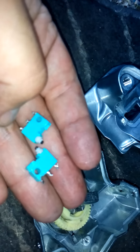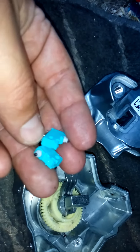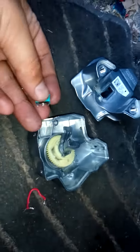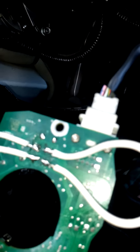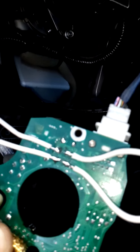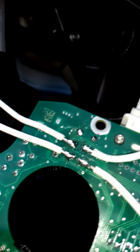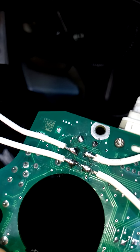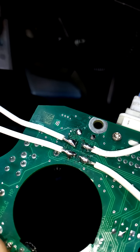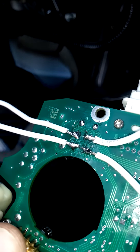What I've decided to do is get the car started using the switches and jumper wire. I pulled out the switches by going to the back of the board. There are three solder locations on the back. I bridged those three locations with one piece of solder while my girlfriend pulled out the switch, and that did the trick for getting the car started.